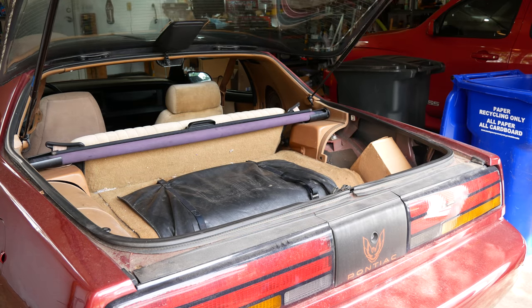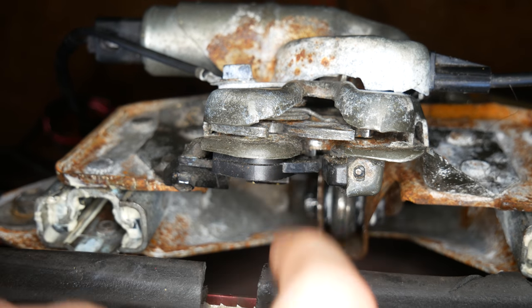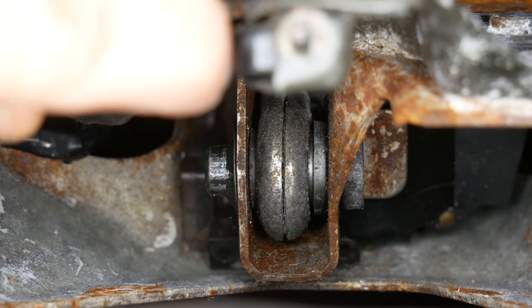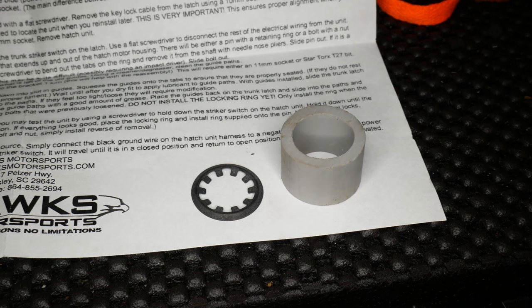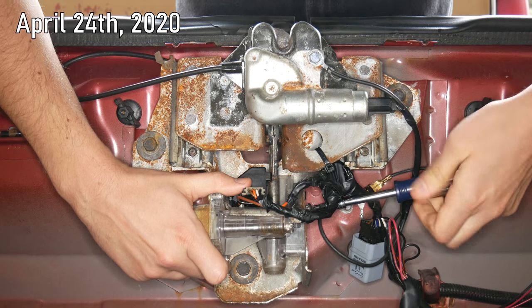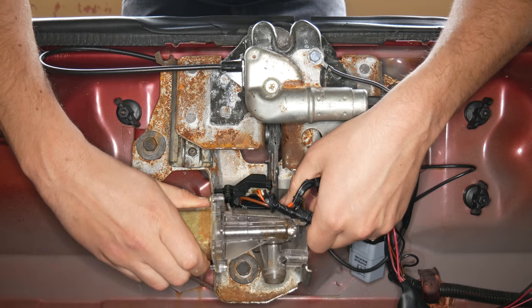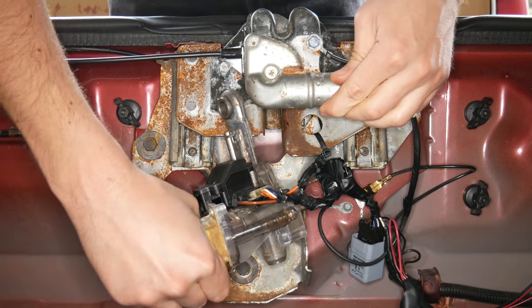It just goes to show that even with new parts - especially cheap ones - there is no guarantee that they're going to work. Around the same time we figured out the relay problem, there were a few other things we wanted to try to improve - one of which is the plastic bushing for the pin in the gearbox assembly, the one that the guide replacement kit included a replacement for that unfortunately didn't fit our car. The bushing is pretty worn out, and even though the kit part didn't fit, I thought I might be able to find some kind of replacement if I took the bushing out and measured it. So once again we ended up taking the gearbox out of the car, removing the flat lock washer for the pin with a flat-head screwdriver, then pushing the pin out before sliding the motor and gearbox out the bottom.